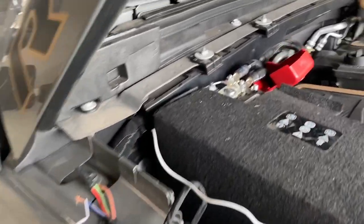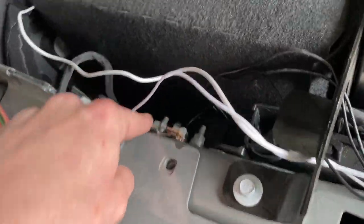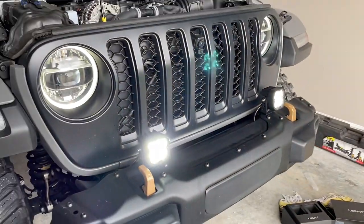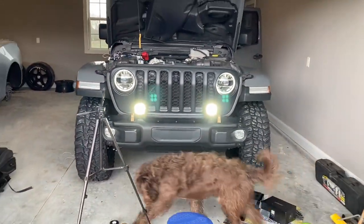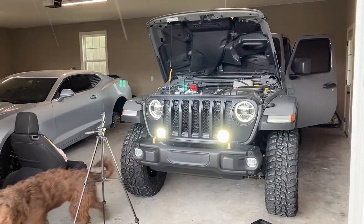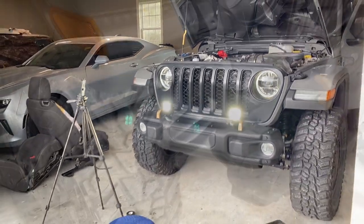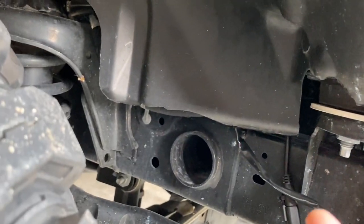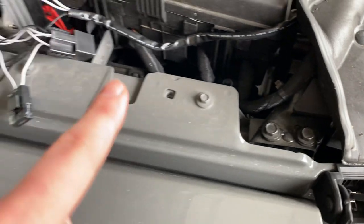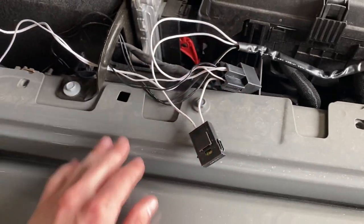As you can see here, I've actually run my power wire to the battery, remote wire to the auxiliary, and I've got both of my grounds right here on the side. We have light! The placement on these looks pretty good with the other fog lights. On the camera they may show up a little bit yellow — it's just that they're so much brighter, the camera really can't pick it up. They look pretty good. All we've got left is to snug up all these wires down here. I've got it run in right through the fender well right there, brought it up on this side, wrapped it over following back, and I've still got to mount the fuse and the remote circuit for it.